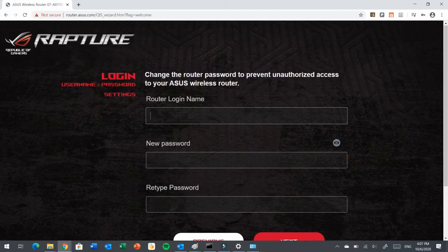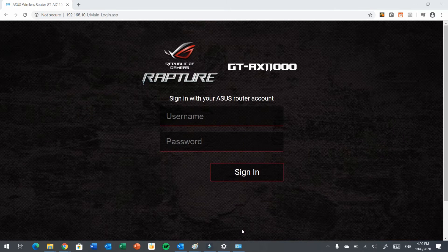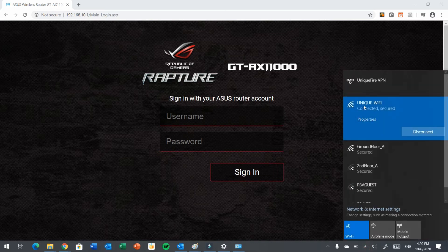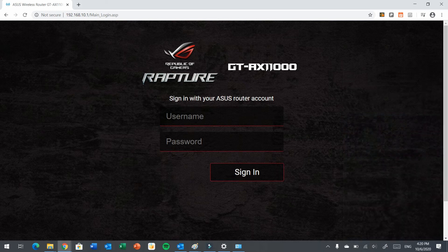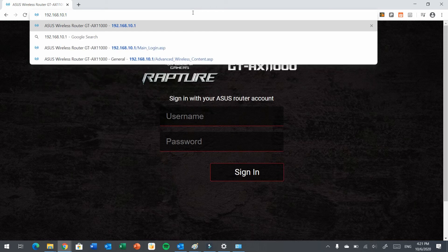Click Next through the remaining steps. This screen will allow you to change your router login name — in this case I will remain as admin and specify a password. Click Next and the router will be rebooted, meaning your initial setup is complete. After the initial setup the router will automatically reboot. You can then connect to the SSID — in my case I configured it as Unit-Wi-Fi. Once connected, you can go back to the configuration by typing 192.168.10.1, which is the IP address assigned to this Wi-Fi access point during initial setup.